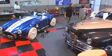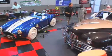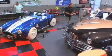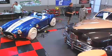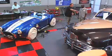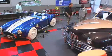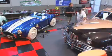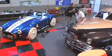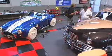But I don't want to limit people if they don't want to use a rotary, that they can't jewel. To me, jeweling is just doing an extra polishing step, working surgically clean. You've got to get all the residue out of the cracks and crevices. Start with a clean pad, buff a section, clean your pad, buff a section, clean your pad, and just slowly squeeze every little drop of shine out of that paint. Then put the wax on.